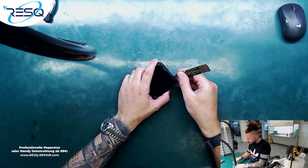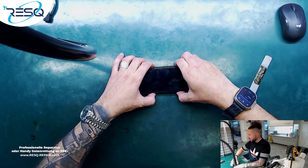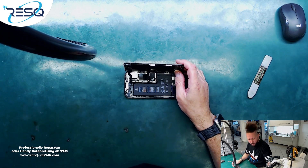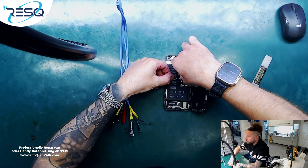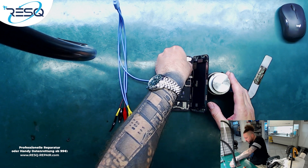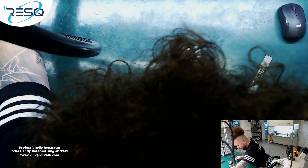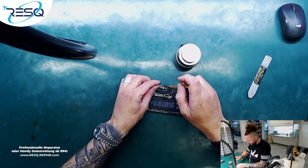It was already opened before. We have an iPhone X — battery is connected, no shield on it. The first thing I want to do is check for boot voltages: is there a short circuit or not? Can the device boot or not? I emulate 4.2 volts with my DC power supply. We're going directly to 3.3 volts and about an amp — and we hear a little beeping sound. So we are short-circuited here, and data is pretty important. Let's find a fast way to get access to the data on this iPhone X.